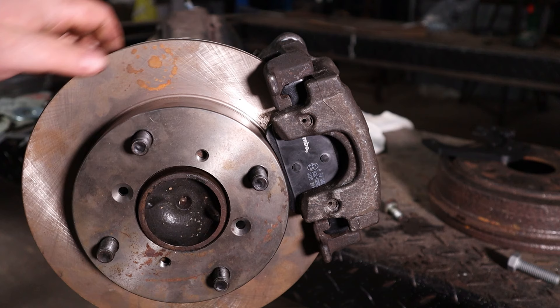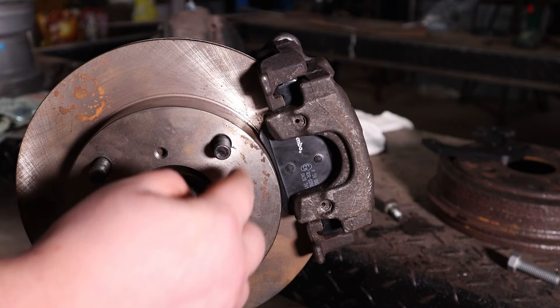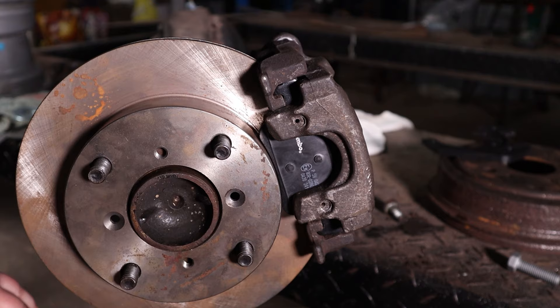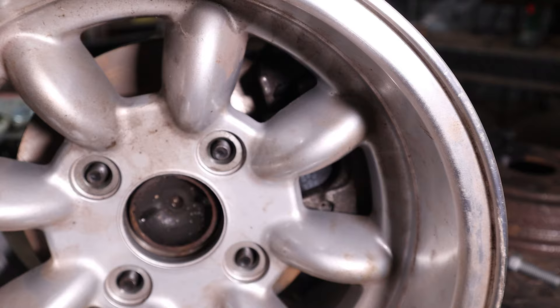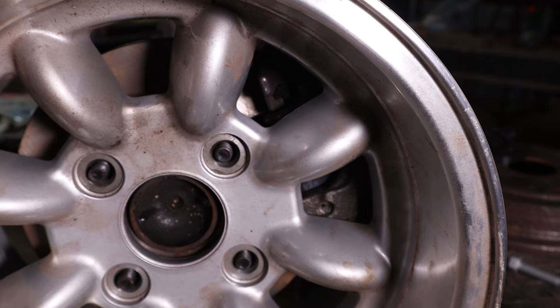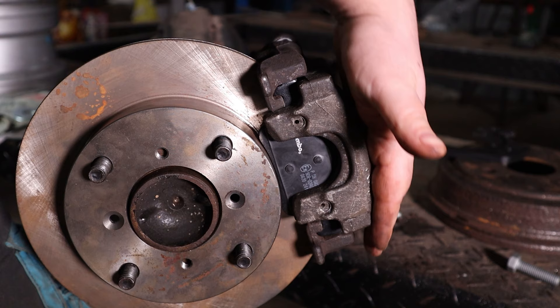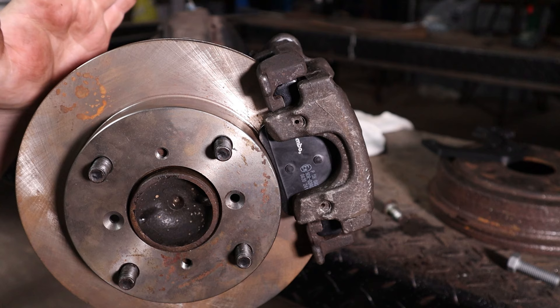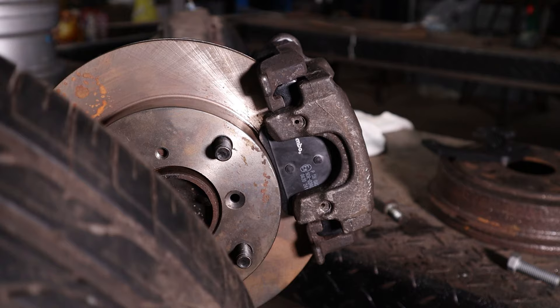But that's not the biggest problem. The biggest problem is that I have to space the caliper out more because it was still hitting the rim of the disc itself. I know — I tried another disc, it is the same disc but another brand — it's still hitting the disc a little bit. It has to go more outwards than it already is. I could just trim off a little bit of that pad below where just the iron is — I'd rather not do that but that is a possibility. But the biggest problem is I just cannot get the wheel on it. So does this setup fit under a 13 inch wheel? Well yes, it does fit under a 13 inch wheel, but just not the 13 inch that I want to install. This other wheel is also a 13 inch — it is tight but it still fits.